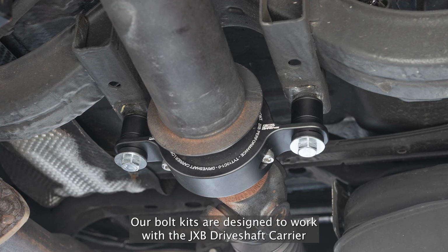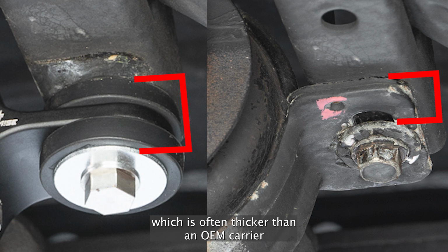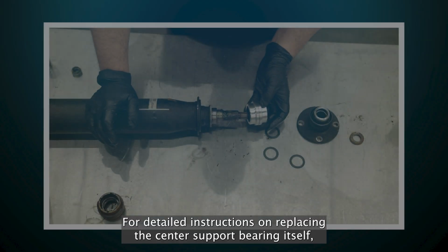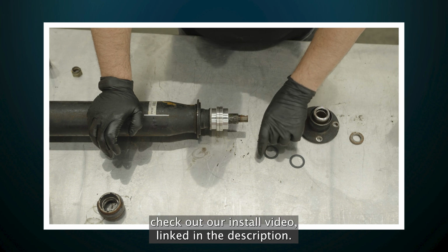Our bolt kits are designed to work with the JXB Driveshaft carrier, which is often thicker than an OEM carrier, so you'll want to check that your original extended bolts have enough threads prior to installation. For detailed instructions on replacing the center support bearing itself, check out our install video, linked in the description.